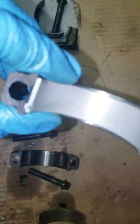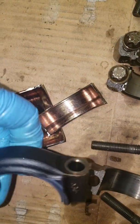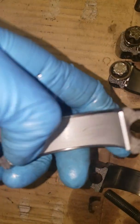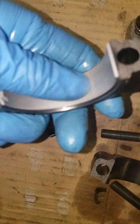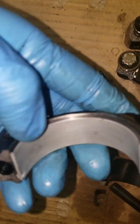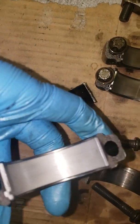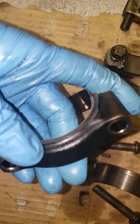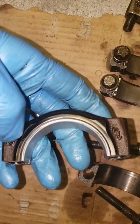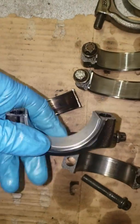I've already put a new bearing in this cap. This cap has taken a lot of abuse — it's blackened from all the heat from that spinning bearing. It's not getting the proper oiling through here to keep it cool. The oiling doesn't just provide a cushion or just lubricate the moving parts and keep them separated — it also carries away heat. So with the absence of oil, this rod took a lot of heat. I can bet any amount of money that this cap is no longer round.